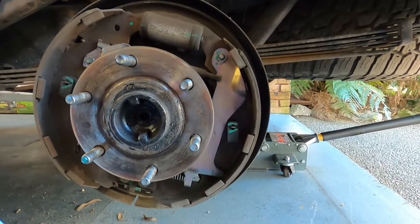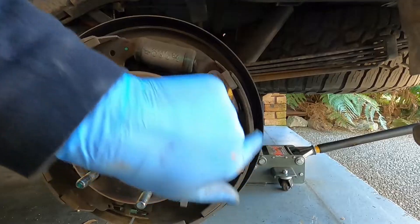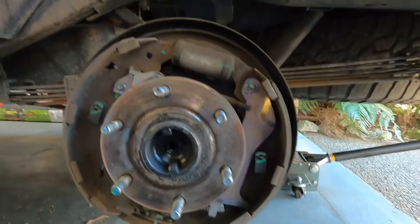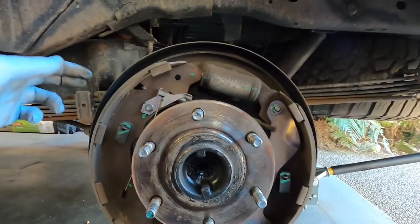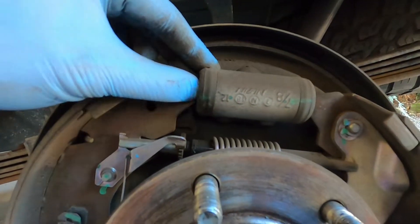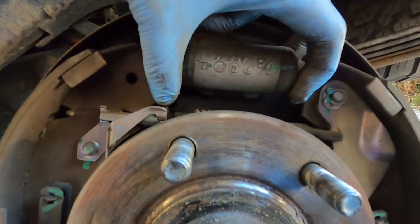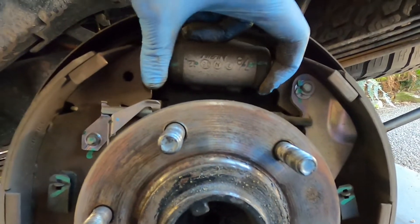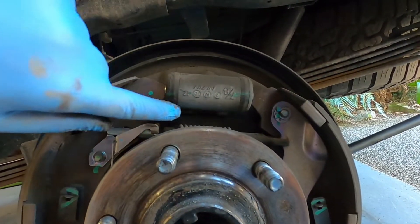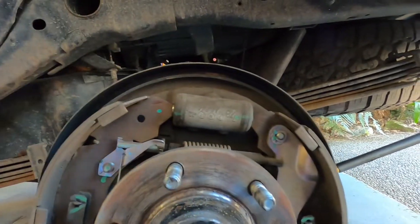The trailing shoe has about 40-50% left, but you always do them as a set anyway. While you've got the drum off, check this is your slave cylinder - your wheel cylinder. You should be able to push the rubber boots - if it makes a squishy noise it means there's fluid in there and you've got a leak. Generally you'll see the fluid around there if you've got a leak. They're pretty uncommon these days. Once done, just roll the drum over to let all the dust out and throw the drum back on.